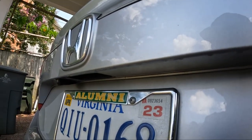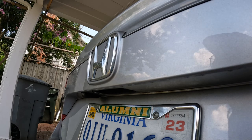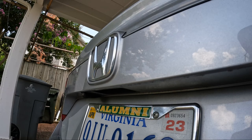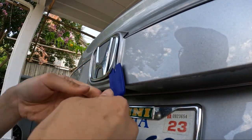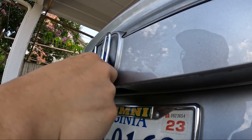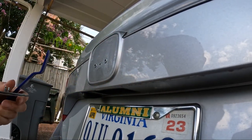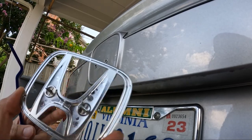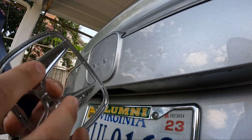Now we're going to move on to the Honda badge itself. We're still going to heat it up with the heat gun, but I'm going to take a plastic pry tool and kind of pry it out because I believe there are two holes holding this badge in. The heat gun will just help soften it up a little bit to pull out. Now we'll go with our pry tool and try to get inside. The two clips are back here in the middle. You just heard that pop — that's one. You have these two clips holding it back here and you just pop them out with a trim tool.